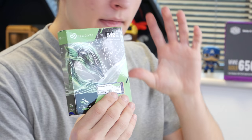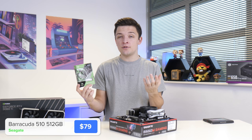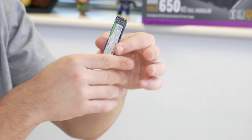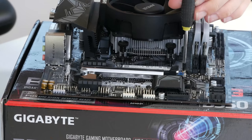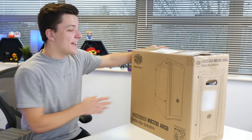Can't forget this important part — our SSD choice today. This M.2 drive is also going to go into our motherboard, providing us with some really fast NVMe storage. The Seagate Barracuda 510 is a great entry-level M.2 option that still gives you the performance you'd expect from an M.2 drive. The teeny tiny screwdriver has returned to remove the M.2 retention screw on our motherboard. Once you've taken that out, line the notch on your M.2 with the slot on the motherboard, then fasten the same screw back down. And just like that, the motherboard assembly is actually complete.